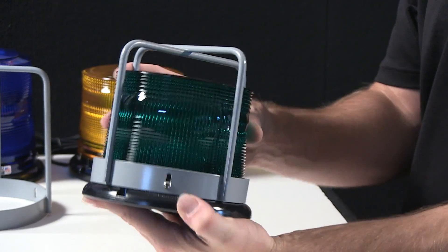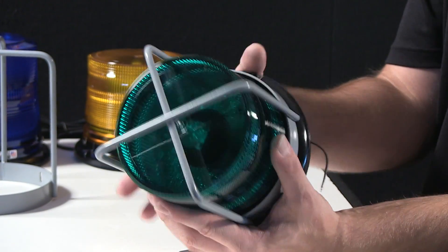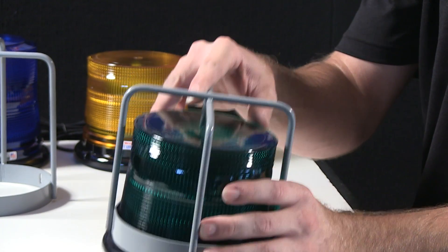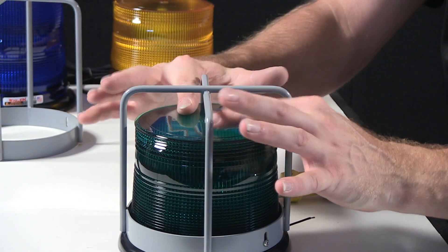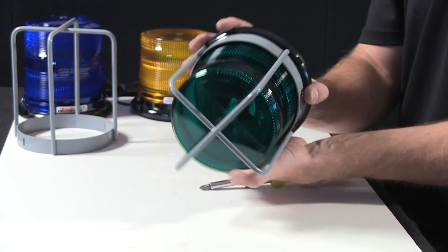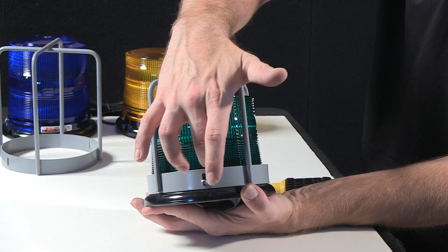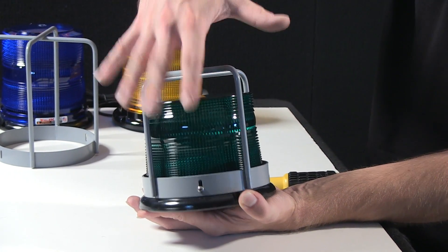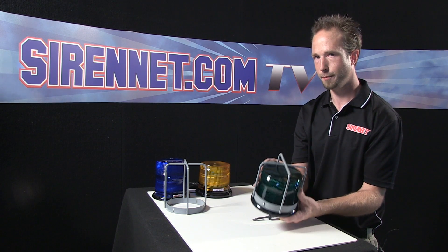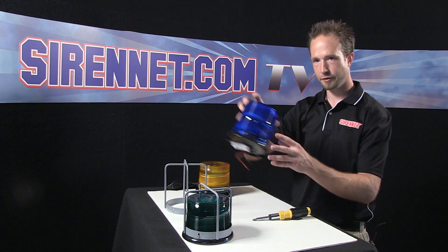You can see that the branch guard is affixed with two mounting screws — one in the front, one in the rear. As far as profile goes, it's nice and tight around the beacon, with some spacing between the top and the X here. So if it does take an impact, there's spacing so your material doesn't hit the top of your dome — 360-degree protection all around it. The base won't be within the dome's optical beam point, so it won't have any impact on the light output your beacon produces. That's the low version; I'll go ahead and put together a high as well.